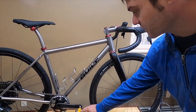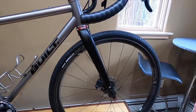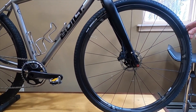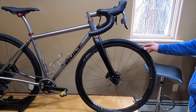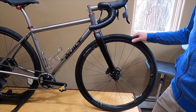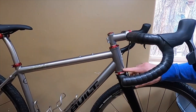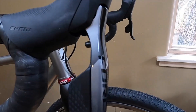So this bike, to maintain some decent toe clearance with the front tire, we've utilized the Seven Cycles Matador fork with a 55 millimeter offset, and that puts the head tube kicked back in the 70.6 range and really gives you that front center distance that we're looking for. It also gives a really nice ride quality with high speed stability and stability through rougher terrain. It is a tapered steerer fork — inch and a half to inch and eighth tapered steerer — housed inside the 44 millimeter head tube of the frame using the Chris King Inset 7 headset.